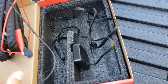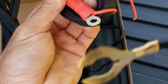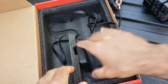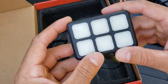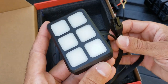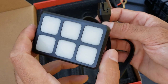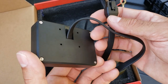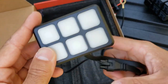It also has a lead on it — the black wire is your ground. Then here's your red lead, that'll go to the battery or something. And then we have our blank switch panel here, and you can see it comes with one long wire, so I guess this runs through your firewall into your engine bay. This is really nice so that you don't have a million different little wires going back and forth from under your dash to your engine bay for every accessory you add to your vehicle, ATV, or whatever you're going to run this on.